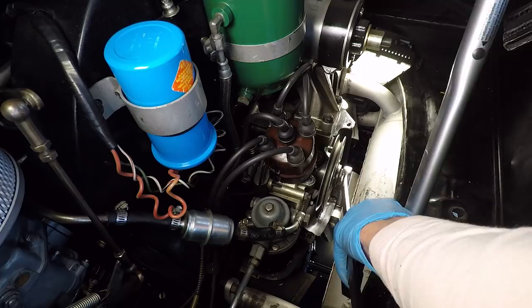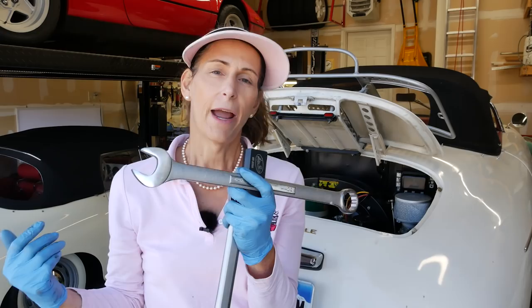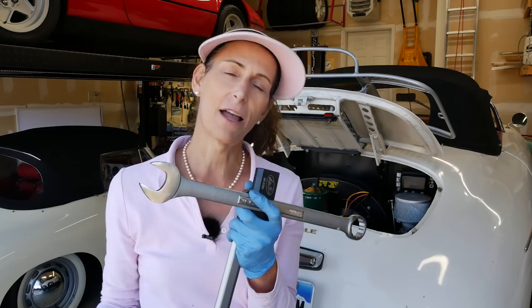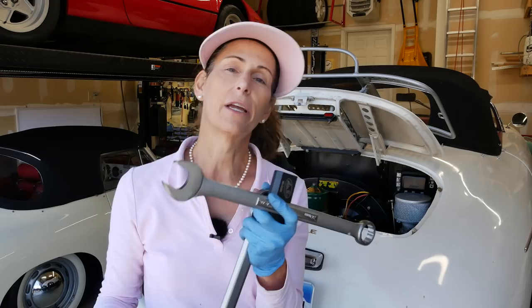This crazy contraption works really well. The one thing I messed up was putting the car in reverse, which is the absolute lowest gear. I was thinking reverse is the strongest gear, but the engine has the most torque multiplication in that gear, making it worse. Put it in a high gear and the engine will have more difficulty turning the wheels, so it locks in better — and sure enough, it worked perfectly. Our pulley is back on and torqued to spec.